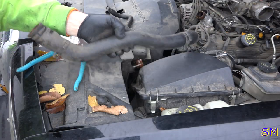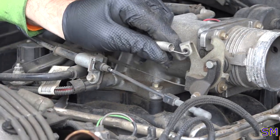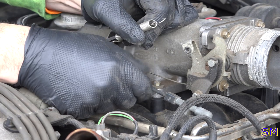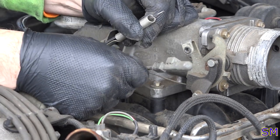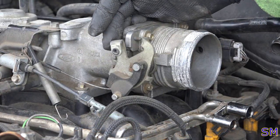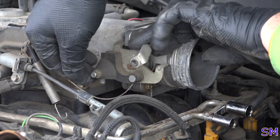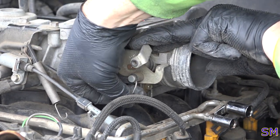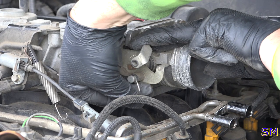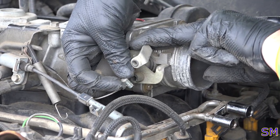One upper radiator hose out. Next, we're going to take off all of our control cables here to go to the throttle body. That one's already unplugged. Wrong clips. Alright, to undo the throttle cables really easy, you go whomp, full send on that. Push the cable, give it some slack, and simply pull the retaining pin out of it, if you want to call it that.